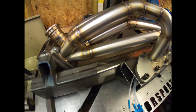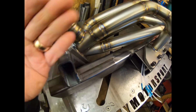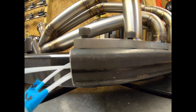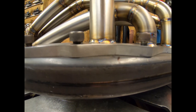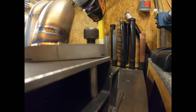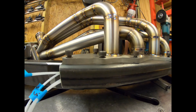We've unbolted this side now. I've put one of the bolts and nuts back in here to stop the manifold tipping over and lifting up on this back edge, because obviously the weight's overhanging there. But as you'll see, these are all undone now, and it has stayed almost perfect. This side has the most deviation but it's very hard to show you — that is it. So I'm really happy with the way the flange has stayed flat.